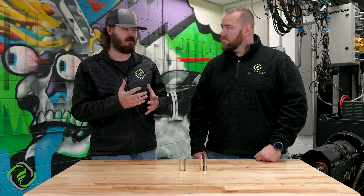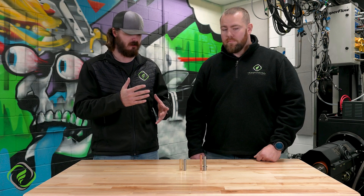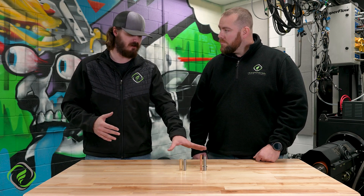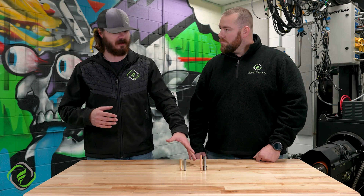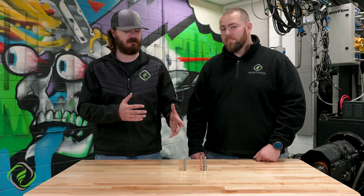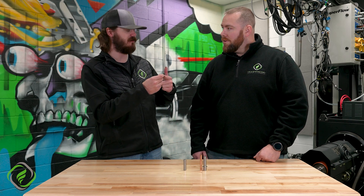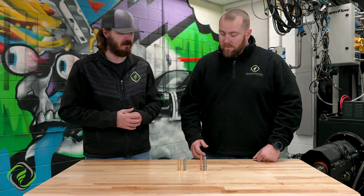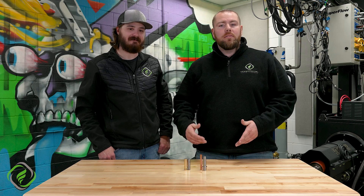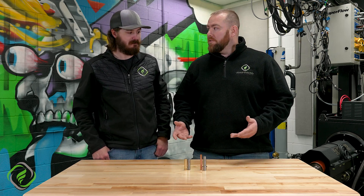Any kind of clearances as far as valve guide — what are some of the different things? We obviously have these different looking things up here and we'll get into that in just a moment, but let's go over clearances for just a second. Because it can't be a press fit between the guide and the valve stem itself, right? So what guides come into what heads, what are their purposes, and what are the benefits of running different materials in different cylinder heads?